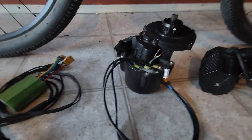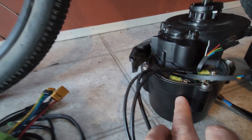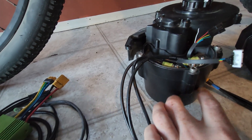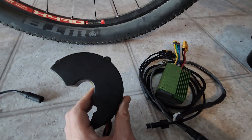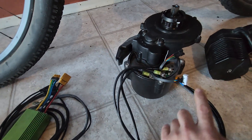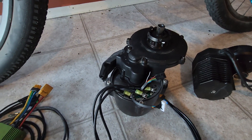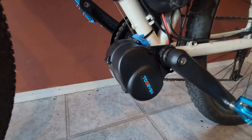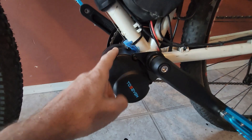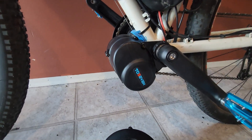Before I get it on the bike, there are a few design tasks to do. The way this motor assembles, the casing is held together with the controller in place, so I'm going to have to come up with something for the controller cover that allows you to get it nice and tight to keep the motor together firmly. I was initially going to consider hollowing out the stock controller and using that in place, but that would have wires coming out the bottom of the motor, and I really want to change the wire exit location so they're not underneath in that exposed position. As well as the tuning for the DM01, we also have tuning completed for the smaller motor, so it'll be interesting to see how that small motor handles the high power — we were getting up to 22,000 RPMs out of that one with the ASI.